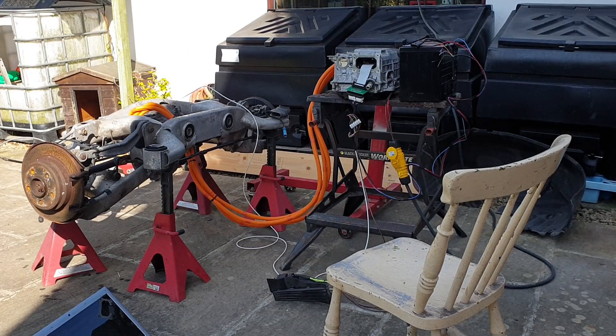Hello folks and welcome to our outside broadcasting facility — such a fine day. We've got some wiring and some motor content for you. What we have is our Lexus RX 450h rear motor mounted in our E39 rear subframe. Over on the little table there we have a Toyota Yaris inverter/converter with the version 1C logic board. There's a 12-volt battery on the table beside it, and we're feeding about 150 volts DC into the high voltage system from a bench battery pack.